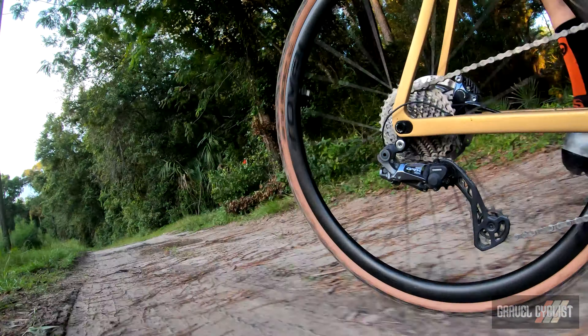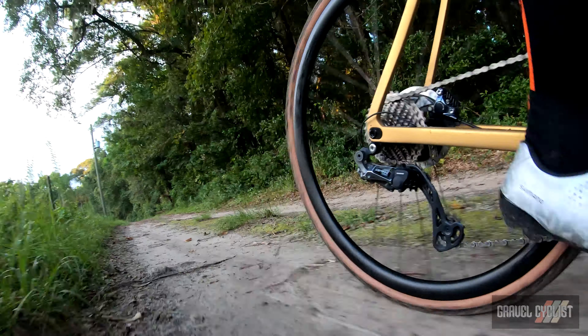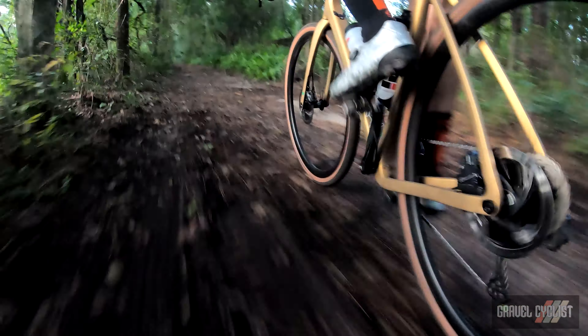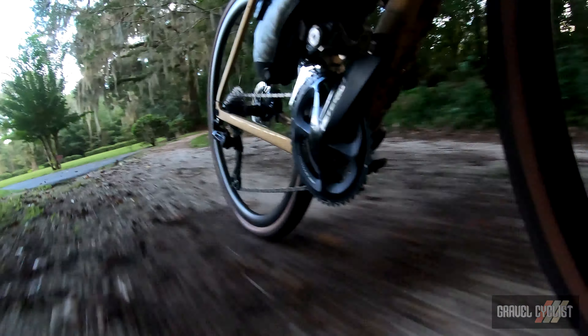But onto mixed surfaces, gravel, single track and so on, they feel very harsh — riding with almost a plastic feel, for lack of a better term. Drop them to 25 psi, or if you dare lower, and they feel much better — with an excellent feeling of comfort, traction, and confidence when cornering. Stonking it hard on loose conditions does not faze the Connectors, and the widely spaced blocks on the side of the tread provide additional grip when you drop the pressure.